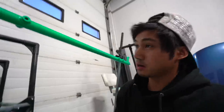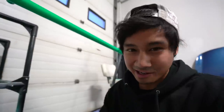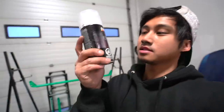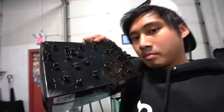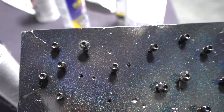The bar is a lot greener now but we're only on our second coat — I plan on doing at least four so we can get it closer to that KMR Kelly green. After the fourth coat we'll let it dry for a couple hours, probably speed up the process using a heat fan. Then the next step is to use the metallic spray — this Dupli-Color spray can is what's gonna give you that sparkle effect on the paint, almost like OEM. I tested it out on the bolts from my rally backer, repainted them black and sprayed it with this Dupli-Color stuff — it's almost like a rainbow effect, super sparkly.